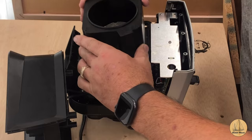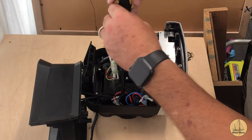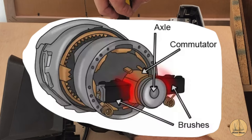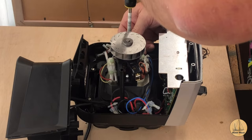It's about the things you assume, right? I see these screws I started to undo before - they're actually to hold this piece in place. Good look here at the brushes - just want to make sure they're all good. They might just have a little carbon buildup on them and that could be the only thing wrong with it. Who knows. And yes, I have it unplugged in case anyone's wondering.